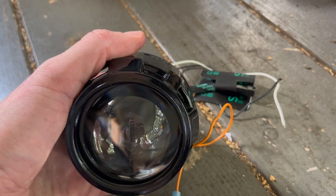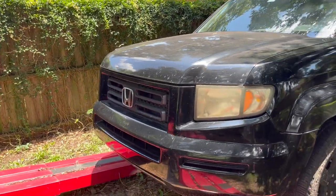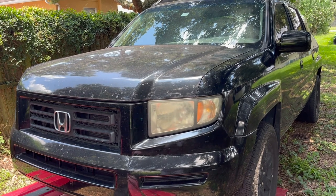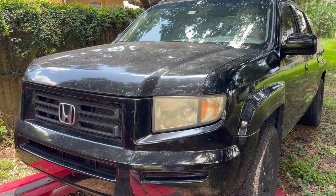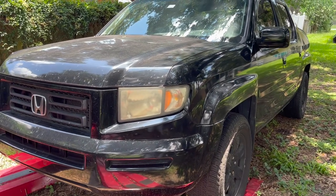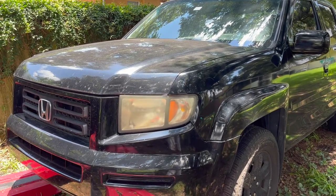The video is gonna be very detailed, so there's gonna be at least two, probably more, parts — subscribe if you want to see the next video. To get to retrofitting the headlights, the first thing we're gonna do is remove them. Some videos recommend first taking measurements next to a white wall to see how high the beam should be from 20 feet, but I'm not gonna do that. When you have regular halogen headlights it's very tough to figure out exact dimensions, so I'm gonna retrofit them first and then align them correctly from 20 feet.